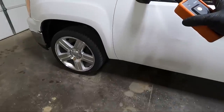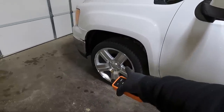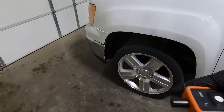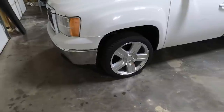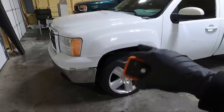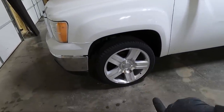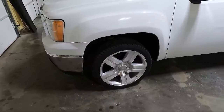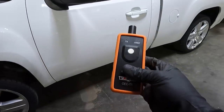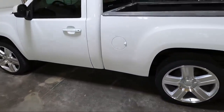Normally you'd go into the driver information center, go to tire pressures, hit relearn, and then start at the front — the horn honks, it chirps, you go to the other side, then the back, then the last one. However, my tire guy had the ability to program these while they were out, so he did that while mounting them. I took it down the road and back to make sure there were no balance issues. He said they balanced really well — he spoke-balanced them, putting the weights behind the spoke so you don't see them looking through. Not all tire shops will do it, but it's a neat option.